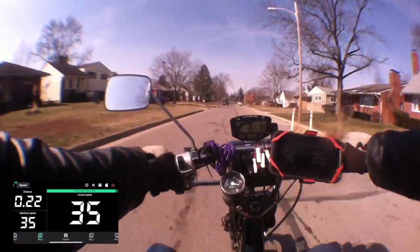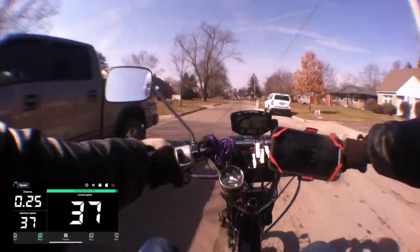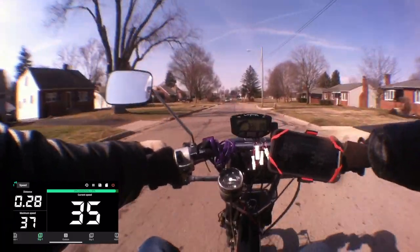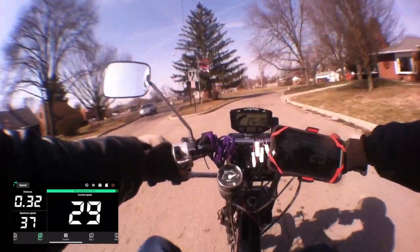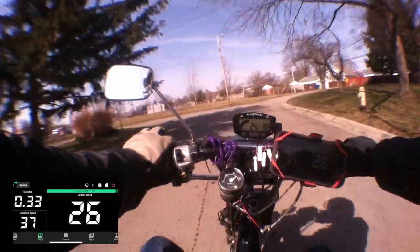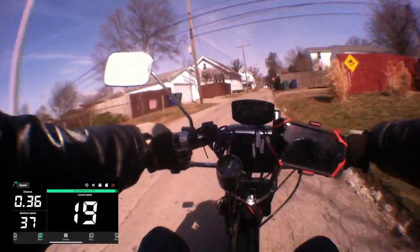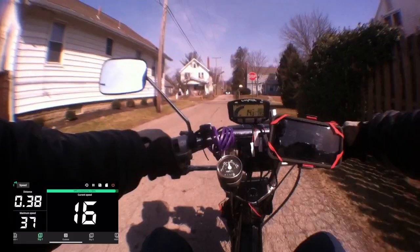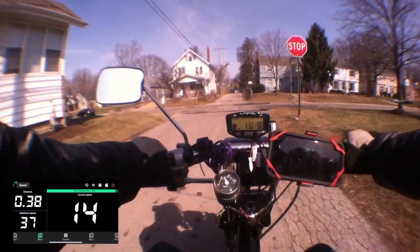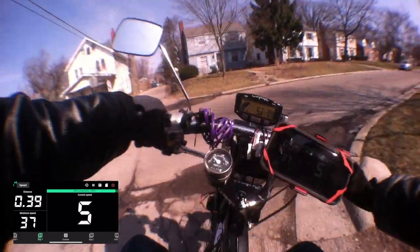And I've got the AX31 belt on, which seems to have been the best performer to date with this particular setup. And for those of you who are not familiar with the setup, we'll start with the exhaust, MLM People's Pipe for the Urban Express, VM18 carburetor with the MLM VM18 intake for the Urban Express.